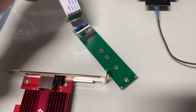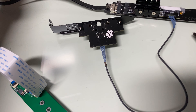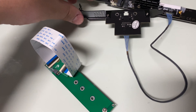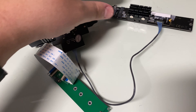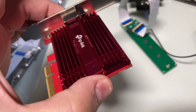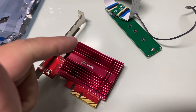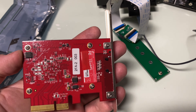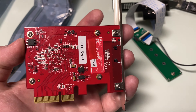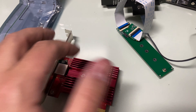Never give up, never surrender. Yesterday we found out the Wi-Fi card adapter wasn't working — possibly this specific one is defective or it just might not work with this setup. But the 2242 connection to that specific laptop did work — I was able to get file transfers. This part got really hot. That's okay because they put a heatsink on it — and I just got a new 10 Gigabit card today which also gets really really hot.